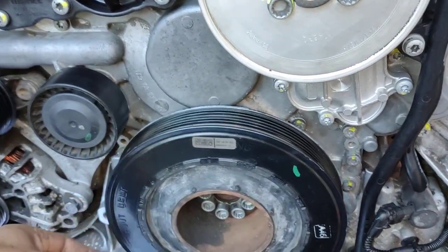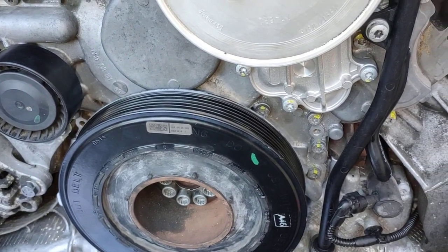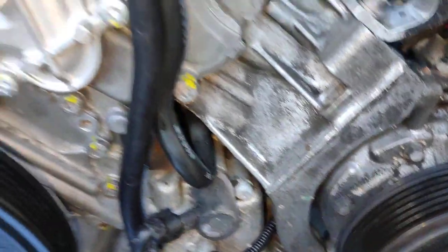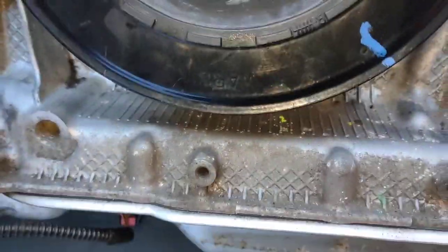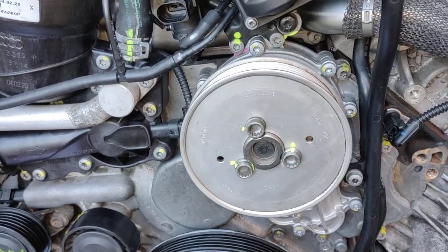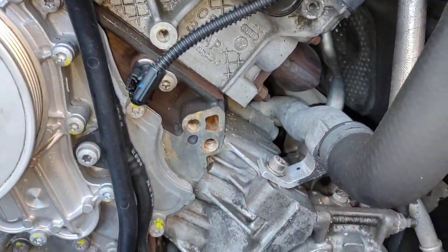Usually when I finish a big job like this, I have the car running in the workshop on the corner for about one to one and a half hours — just keep it running. I keep checking the oil pressure, make sure there's no leak underneath the car, pretty much monitoring the whole system, making sure there's no overheating, making sure it's running smoothly before I actually complete the whole front end.